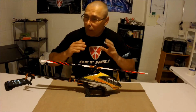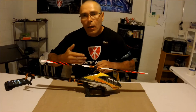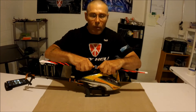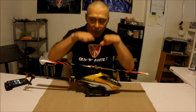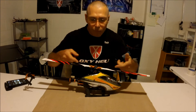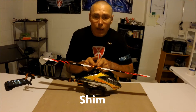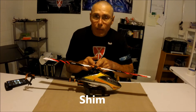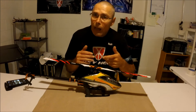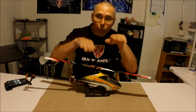Around the 20 to 50 flight area, depending on your fly style, it's very good to periodically check — if you grab your grips and you have any play this way, if you have any play, it's time to go ahead and take your blades off, remove your grips, and add an additional spacer on each side on the spindle shaft.